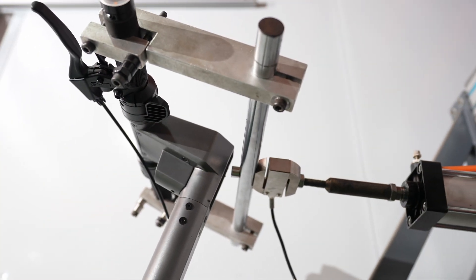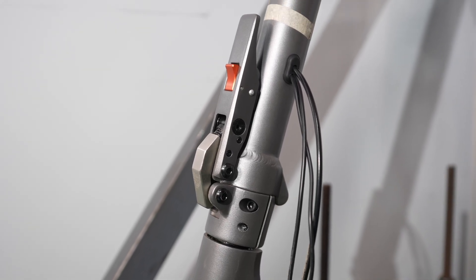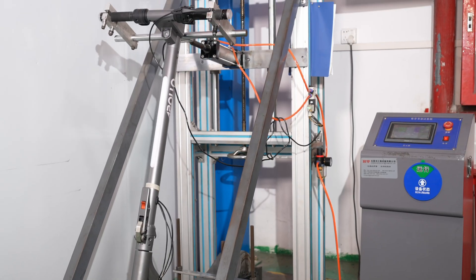We have pretty strong acceleration with our dual motor scooter, but also deceleration with the regen. So it's important to be able to log thousands of kilometers in a short amount of time of this push and pull repetition on the stem. This test is gonna test the direction tube present inside the folding mechanism, which is usually the point of failure — the folding mechanism, the neck of the scooter, and also the stem.